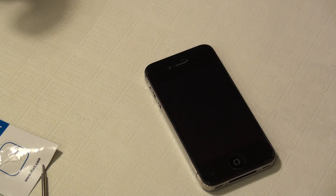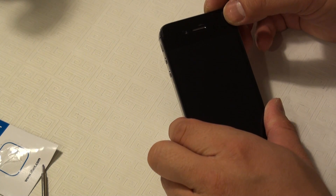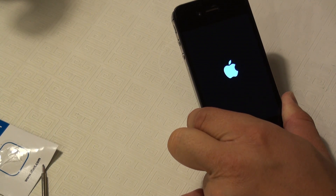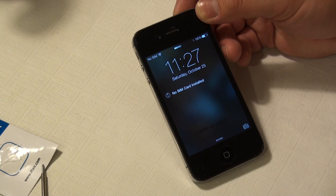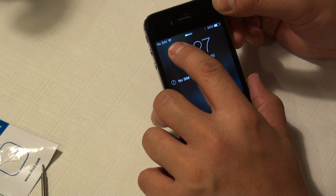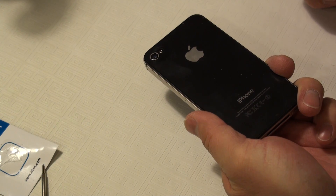Go ahead and turn the phone back on. Most batteries I've replaced do have a charge from the factory, but more importantly I want to turn the phone on to make sure that cellular and Wi-Fi are functioning correctly. I've seen people do repairs where they don't install the spring clip properly or clean it with rubbing alcohol, resulting in no cellular signal due to grounding issues. Now that the battery is installed and the phone is booted up, you can see there's 56% charge from the factory, no SIM, but I do have Wi-Fi — which indicates my grounding spring is making proper contact with the back of my iPhone cover.